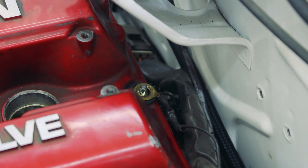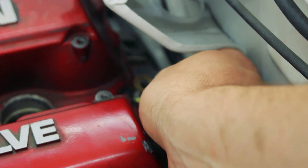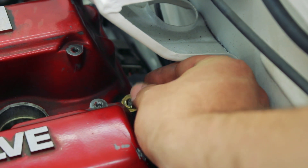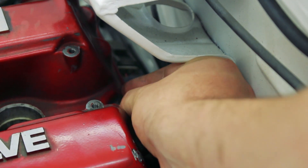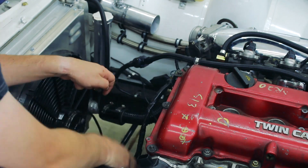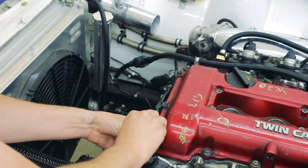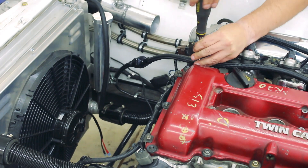As you're reinstalling hardware, ensure that all your grounding wires are back in place before you finish tightening everything — it saves you a lot of time figuring out weird electrical problems. This ground in particular is connected to your coil packs, which can cause all kinds of interesting running issues if it's either not properly seated or not there at all. My wiring harness also has grounds on the other side of the valve cover used for the rest of the lower sub-harness. Once you're all done, definitely don't forget to plug the CAS back in — I have seen people do that simply because they're in such a rush to see if changing out the disk or the CAS made a difference in the running of the vehicle.